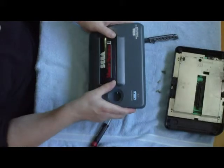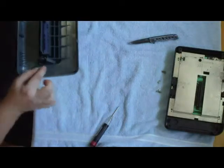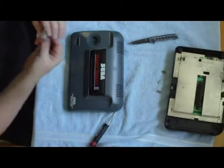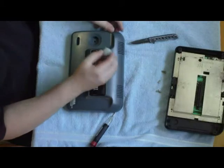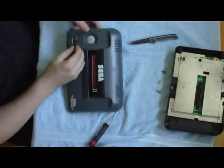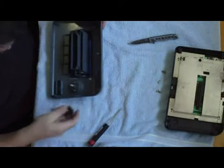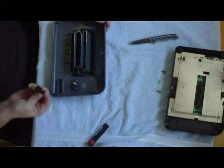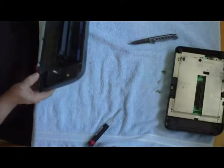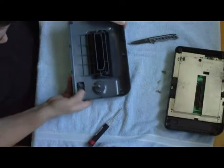Alright, now we've got it through just like normal. Make sure it's all the way on there on both sides. Go ahead and replace your power switches — your pause and power. Make sure the pause button is facing north-south and put it back in. Then your off/on switch — this is a little bit more difficult; you have to do it from the other side. There's no wording and it's the same both ways — there are four clips that you just need to snap it into.